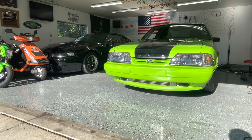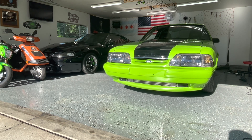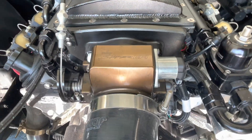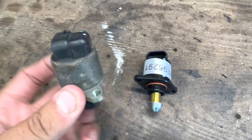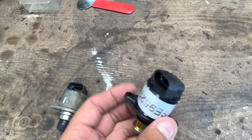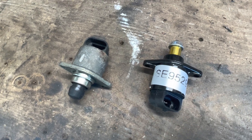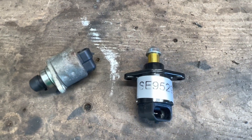What we're going to do today is start the car to show you what it does — it's been sitting overnight. Then we'll swap the wires and hopefully get a better result. For reference, here's the throttle body with the Sniper EFI IAC plugged in. This is the GM IAC, four-pin, and this is the Holley one I bought for the throttle body which didn't work correctly. I thought there was something wrong so I also bought one through AutoZone. None of them work as they should, and the GM one doesn't actually fit the throttle body correctly.